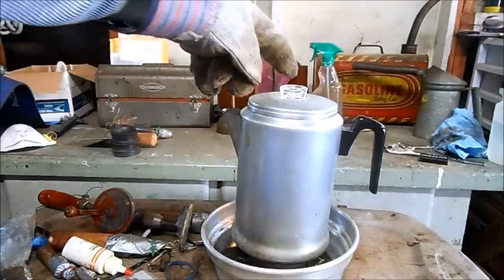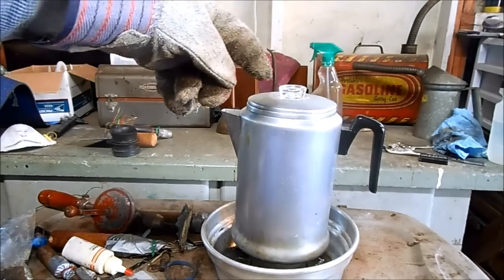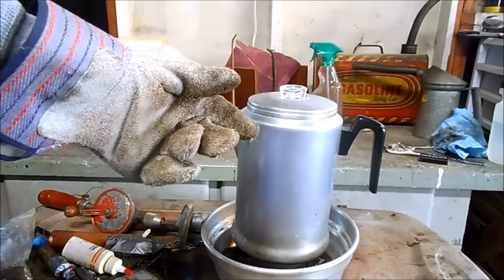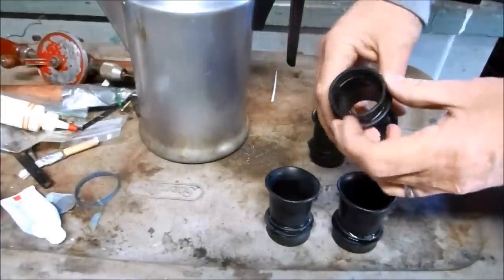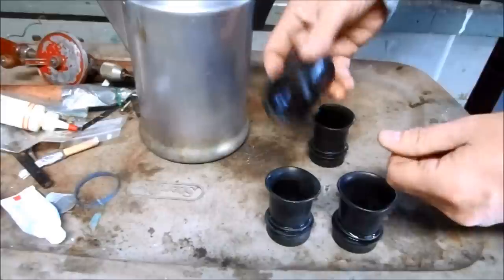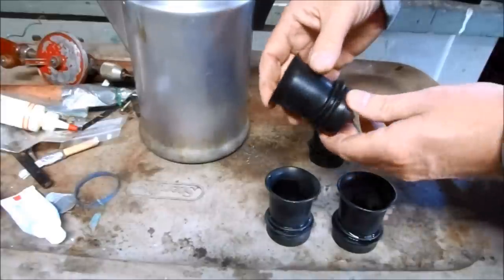I'll let this cool back down to room temperature. It's extremely hot right now and it'll probably take about 30 to 45 minutes. Never touch this thing without using an oven mitt. After annealing, they are a little more pliable, and you could probably pry these on and off carburetors just fine. But don't cheat yourself by stopping here because they'll just get extremely hard again and you'll be back to where you were.